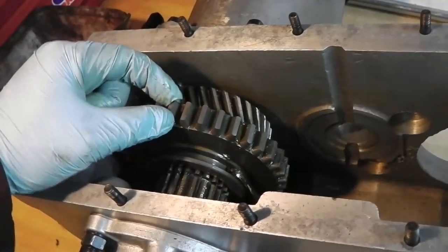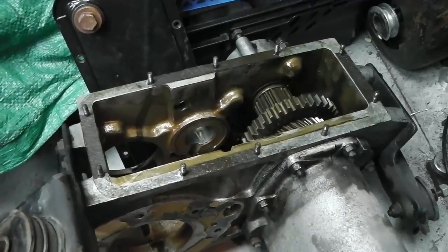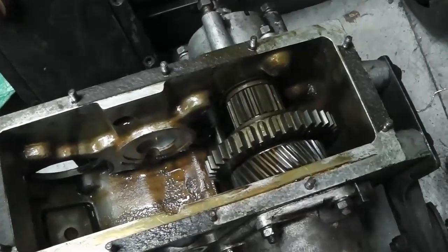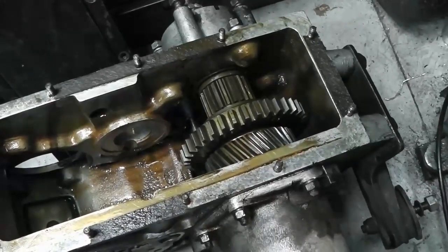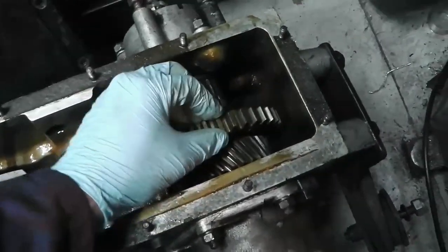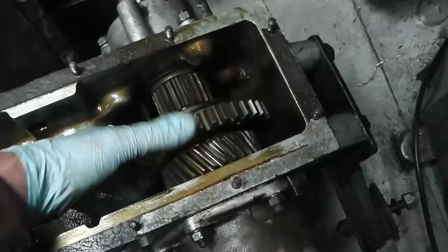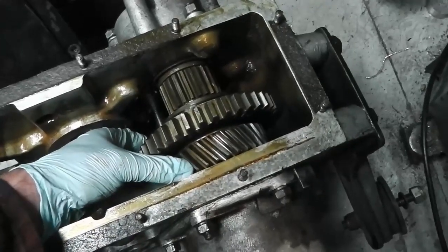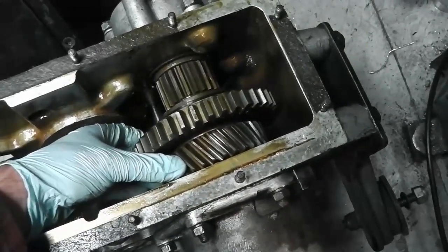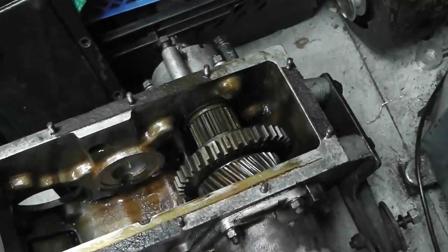That's a good one - brand new. And this is one from a gearbox that's probably been around the clock a few times. This output shaft and gear were original to a Series 2a, a very high mileage vehicle. I can actually lift that one up and down as well, and if I could lock this up you'd see there was quite a bit of rotational play - whereas there isn't any of that with the other one. So that's a worn one that it's replacing.